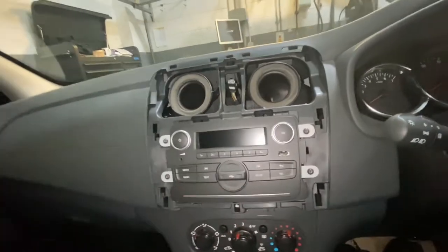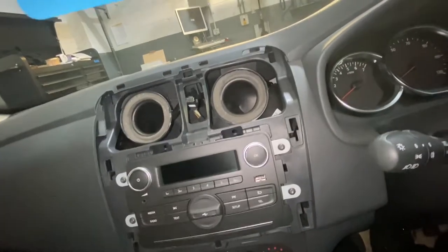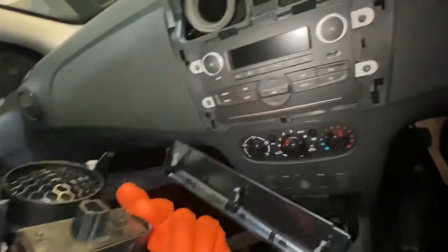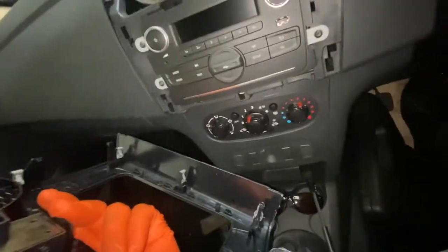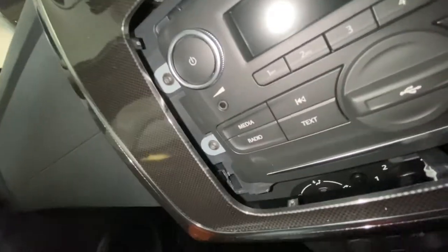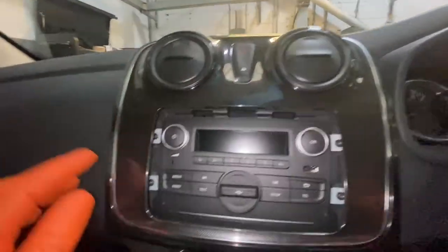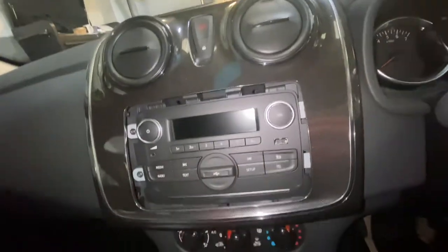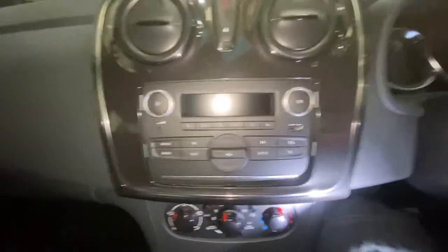The radio is now back in and plugged in. Now we need to plug back in the hazard switch, which also has the central locking button on it, so I'm going to plug that back in. Then just make sure all of these clips are lined up. On this panel, slot the top in first — make sure the clips line up in those holes. Don't just push it straight on or you'll snap everything off — line the top up first and push it down gradually checking all the clips.